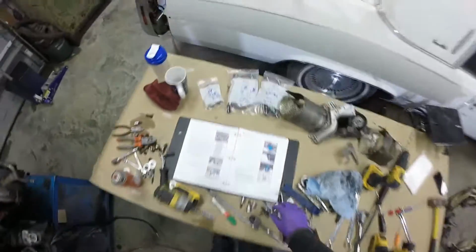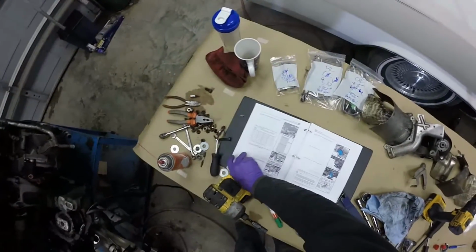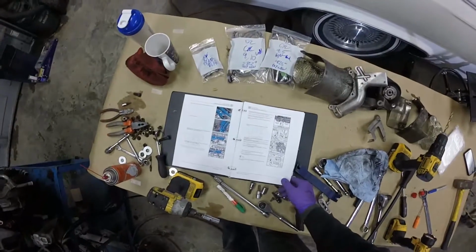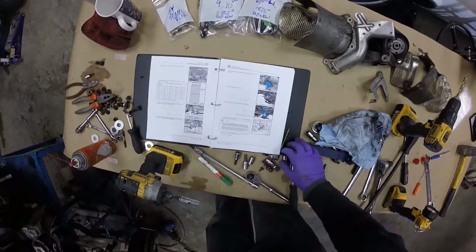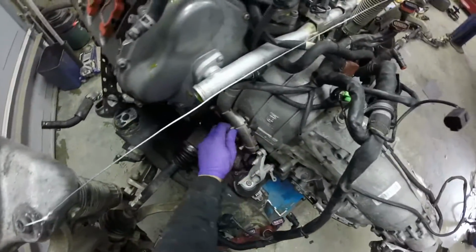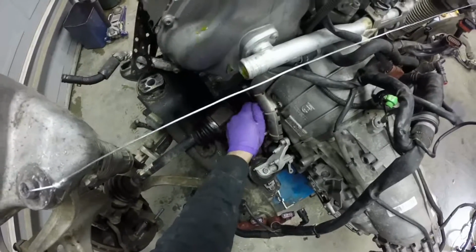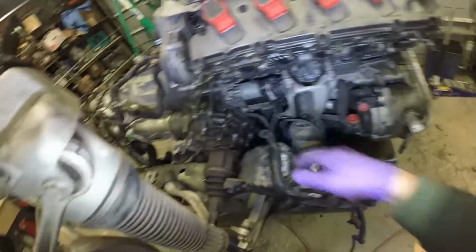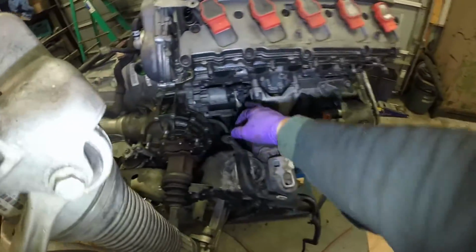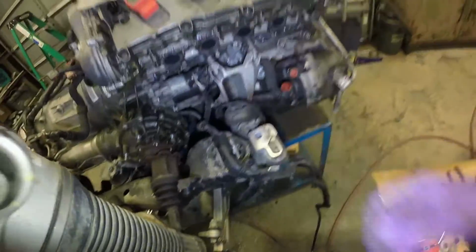Last thing left, sorry, is the Mechatronic Unit. Unplug that. Where's that one? Caution, don't touch it. Yeah, looks like it's just a twist and turn. And the mech unit is behind here. What is this? Oh, that's a ground. All right, I'm going to undo this ground. I'm going to do the starter cable, and I'm going to undo this trigger wire here for the solenoid too.